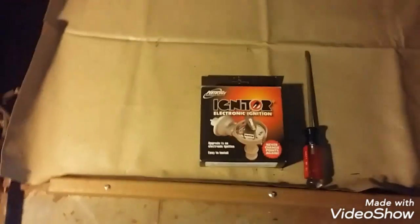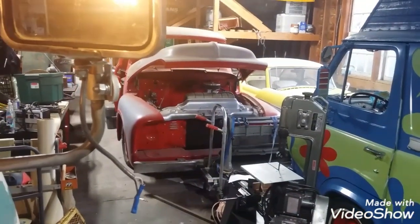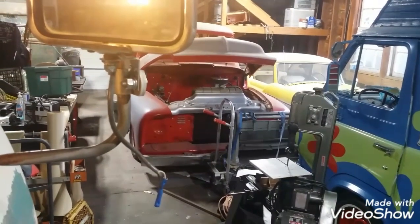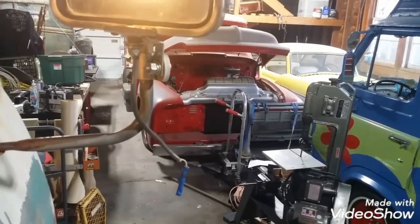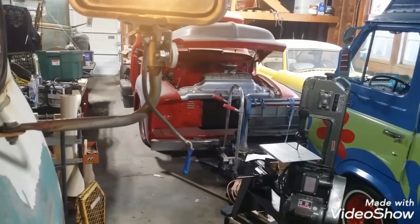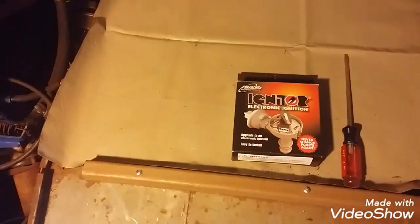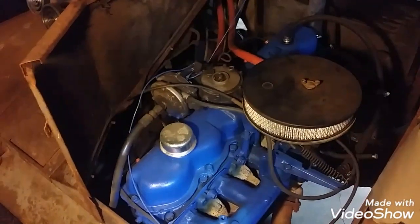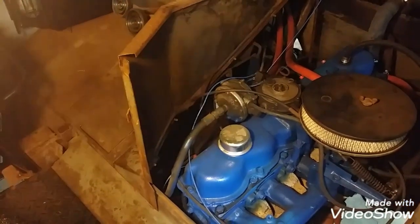This is actually the exact same kit as I put in the distributor on my '56 Ford F100 inline 6, 223, when it was a stock distributor. It's got a modified dual point distributor in it now — a Mallory dual point distributor with a better adjustable advance curve with a Crane electronic ignition. I got a small fortune tied up in the distributor in that thing. These Pertronix kits are less than a hundred bucks. You can get them for practically anything, and if you're not paying attention you can order them for the wrong vehicle — don't ask me how I know.